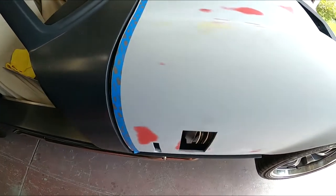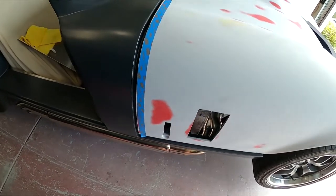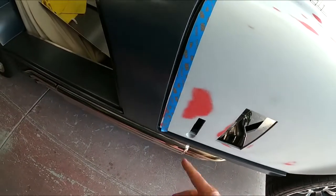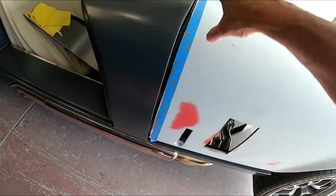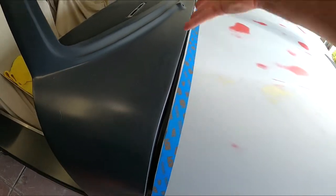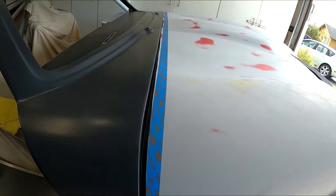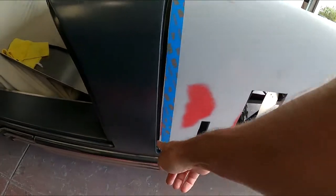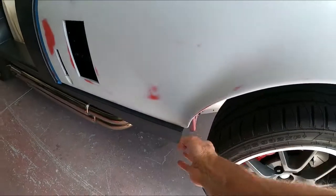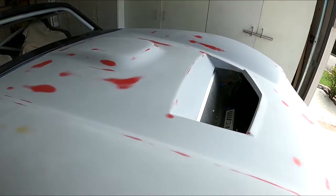I've still got too much gap between the light bucket up front and the hinge. I need to cut more off the back before I can get this thing back further - this side is a quarter inch plus. I'm basically going to try to get this to almost no gap and then gap it properly. I put tape on to mark a straight line so you can see where this nose kind of curves into the top. I'm going to whack all that off, whack the bottom edges, and that should move the nose back about another three-eighths of an inch, get it closer to the seal.